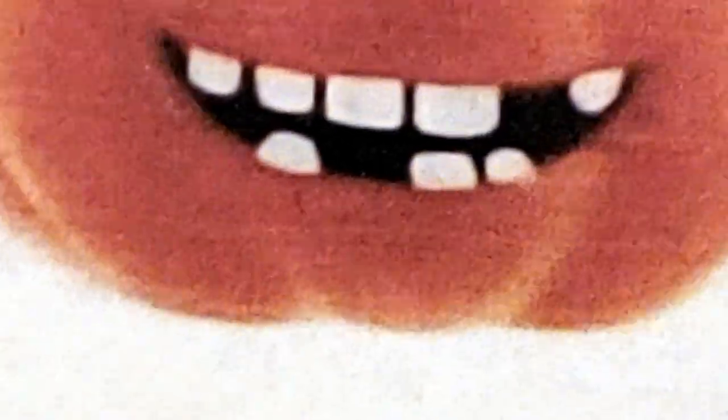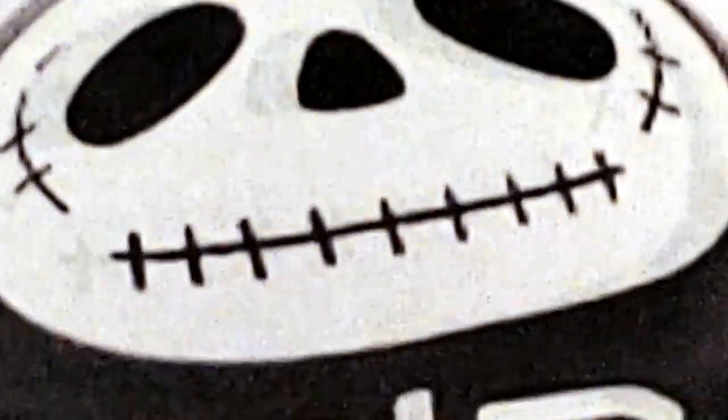Okay, so for those people that have been messaging me about lines in their printouts, I keep telling you to do a printhead clean, but you know what? Do a printhead alignment instead. Okay. Cool. Isn't that so much cleaner? I mean, minus my mistaken dots there. That's not the printer's fault. Much cleaner. Yep. I think it's good.